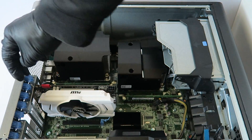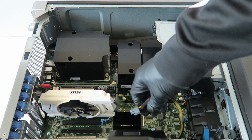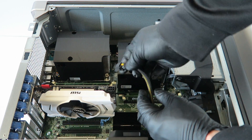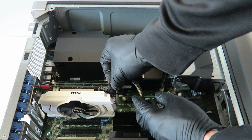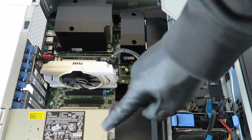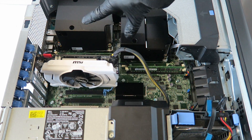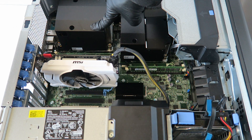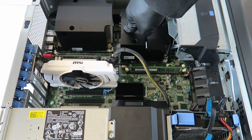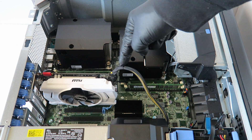The video card is installed. Now you're going to clip it back into the secure clip for the PCI bracket to lock it down, then connect the six-pin power. Some GTX 950s don't require a six-pin, but this one is overclocked so it needs more power. The power supply in here is 635 watts, so you don't have to upgrade that. I've got dual Xeon processors running at 2.4 GHz — four cores each, eight cores total — and I'll be upgrading those in a separate video.